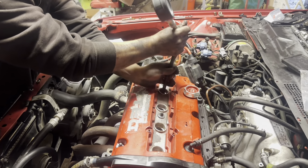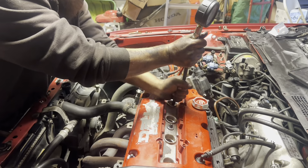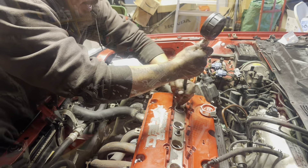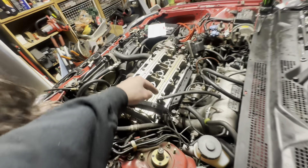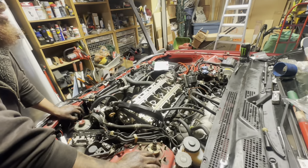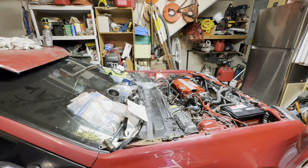We're going to do a compression test to make sure we don't have a bunch of dead cylinders — there were 12 bad valves plus the head gasket so I have faith. We had zero compression in two cylinders, so we think we degreed the cams wrong. The vehicle is at TDC right now.